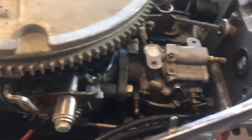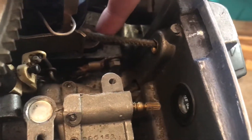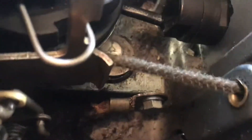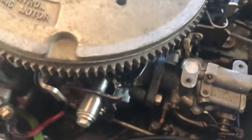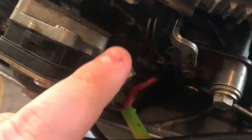So what we did — me and my brother, mainly my brother — is we first started out by connecting all of our cables up here. We ran them through this hole down here, and as you can see there's a ground right to the motor block here. And then we bypassed the neutral safety switch because that broke, by just connecting these two wires together and putting a piece of gasket kind of as a thread.